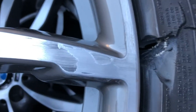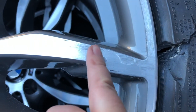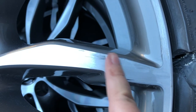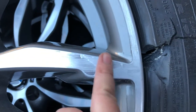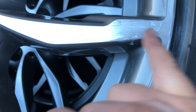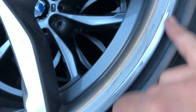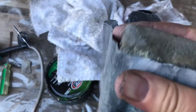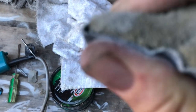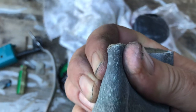This is where I really got stuck in — you can see where there's clear, and the edge between the sanded area and the remaining clear is no longer distinct. I'll take this remaining clear off and continue to work around the edge. I'm using a foam block with the emery paper, but I'm folding it and squashing it up so I've just got that small area between my fingers for precision sanding.